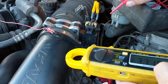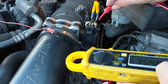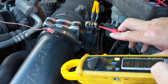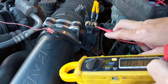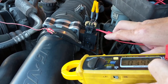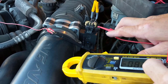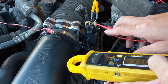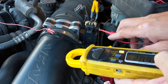These yellow ones are back probes. Back probes means you're going in from the top through the connector. I'm going to use both methods. I put the lead through the connector, through the terminal, and I close the connector, making contact to the sensor or the load. Because I want to make sure that I'm making contact with the load — I don't want to measure the connector out of circuit. I want to make sure it's connected in circuit.